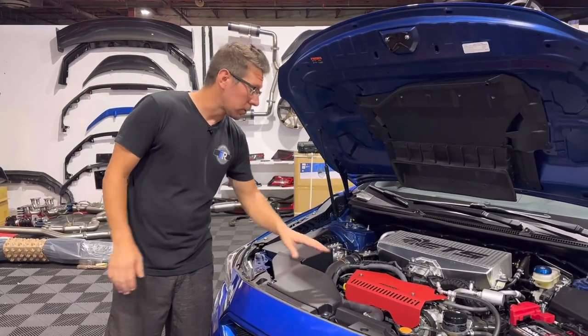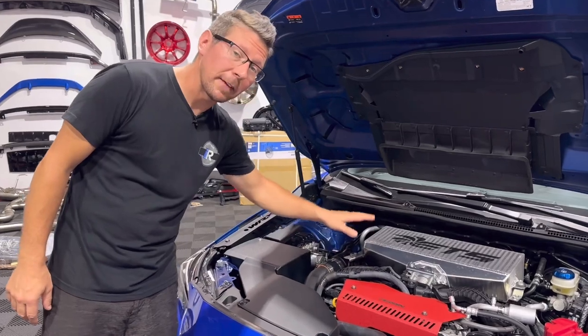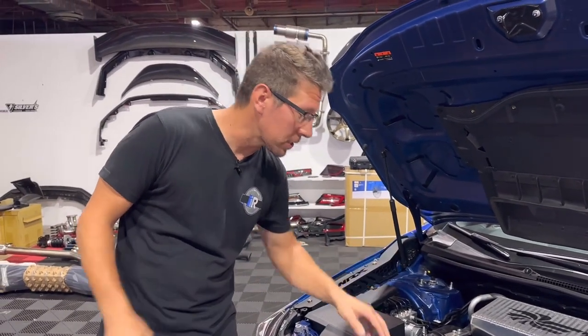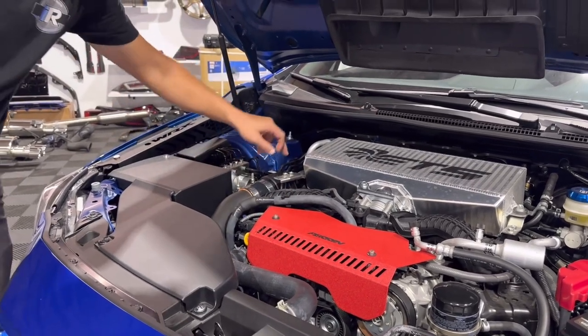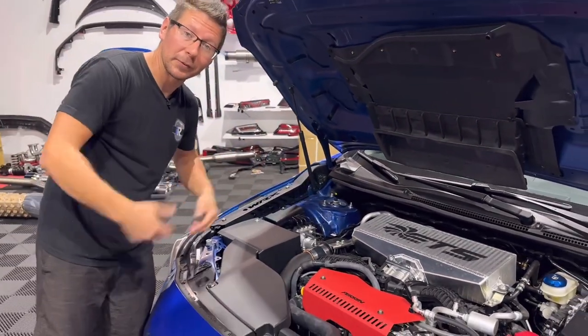For now, let's get this thing on the car. The first step in our installation is to start removing parts, including our serpentine belt shroud and our intercooler. We have some aftermarket parts here, so the tooling's not going to be exactly the same if you have stock parts. In our application, we're going to remove these two bolts for our shroud, and then our eight 12-millimeter bolts for the intercooler and our band clamp. Then we will remove the intercooler.